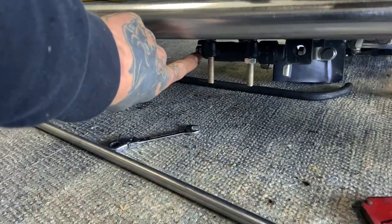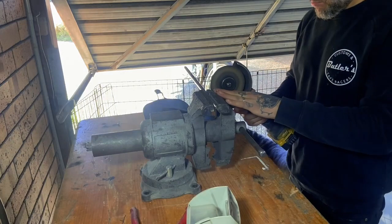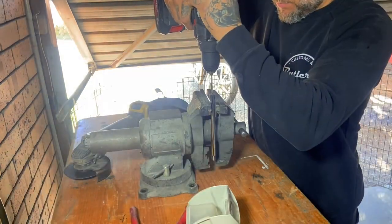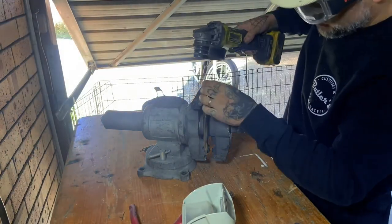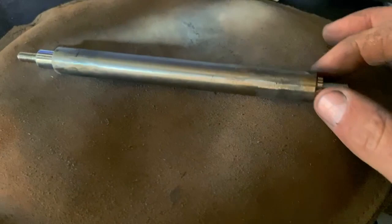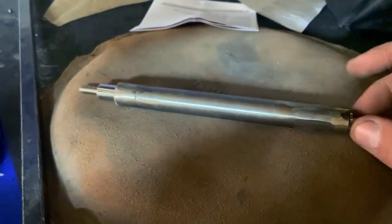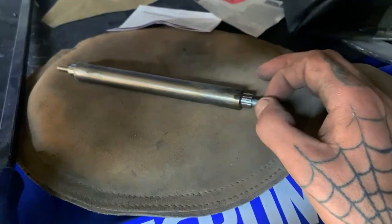Our forward controls are sweet and then we'll run a line from the back all the way up to our rear brake caliper and we should have some rear brakes. This tube was about half a mil too large and was slopping around on the inside, so I've cut the ends off and welded on some machined pieces. Now we don't have any slop and it moves in there perfectly. This will get welded to the underside of the frame so it can float in there nicely without any play. Time to weld that to the frame and get this working.